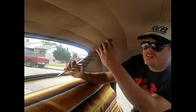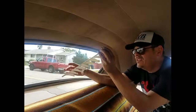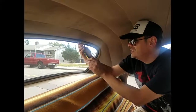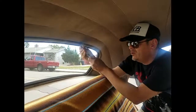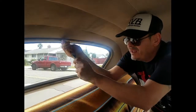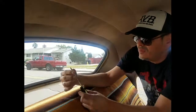On your left and right, it's going to wind up hooking to the top of the garnish. But you first need to loosen up the screws on the garnish. Whether it's a Phillips or flathead — typically it's a Phillips screw — you're just going to back this off a little bit. No need to take it all the way off. This is going to create a little bit of a gap between the headliner and the garnish, so just be careful not to strip the screws.